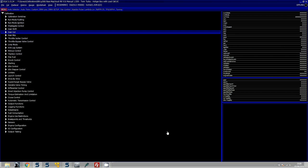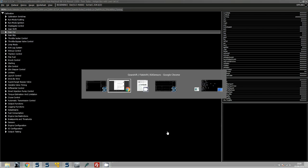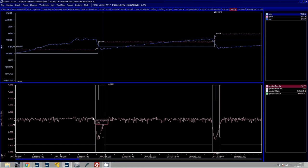Basically, you provide it with a 5 volt signal and the sensor will sit at around 2.5 volts as its rest position. When force is applied in a forward motion to the load cell, the voltage goes up in a linear fashion based on the force applied, and down in the same manner. We can actually see this in the data log - the gear cut input voltage is sat at 2.5 volts, and when the stick is pulled back, the gear cut input voltage drops.